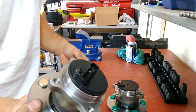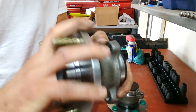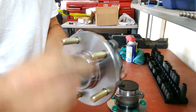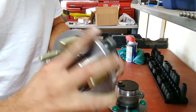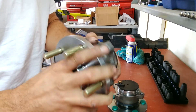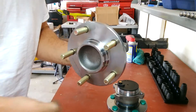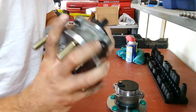Here's one that I'm pretty sure is good. When you get a wheel hub bearing and you spin it, it should feel tight, smooth, and be quiet. If you feel the bearings going da da da da da da as you rotate it, that's evidence that it's a rebuilt unit — not brand new. They reused the old bearings and they're actually out of round. Don't use it, because you'll be lucky if you get 6,000 miles on that.